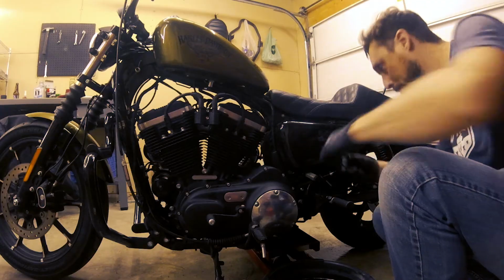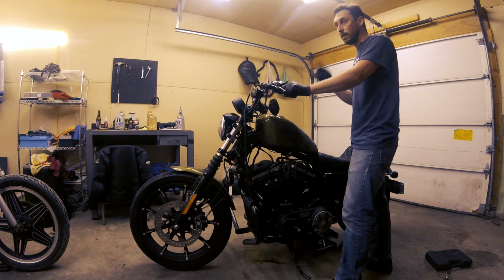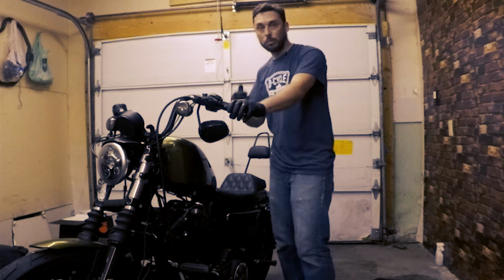And we'll go ahead and reroute the drain hose back up to the frame, and we'll put the clamp back on. So the next step is to turn the engine on, check to see that the oil pressure indicator turns off at 1,000 RPMs. So let's go ahead and open up the garage door and do that.